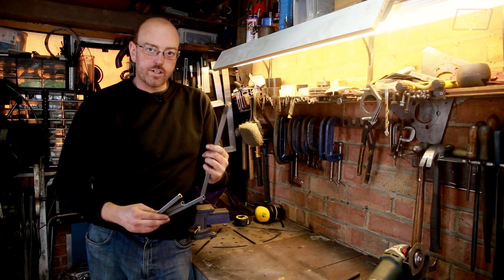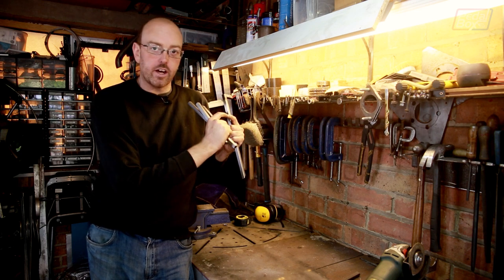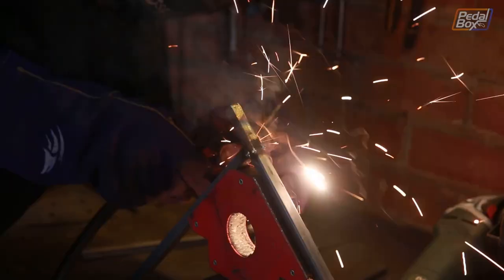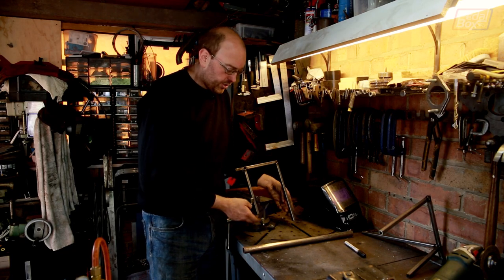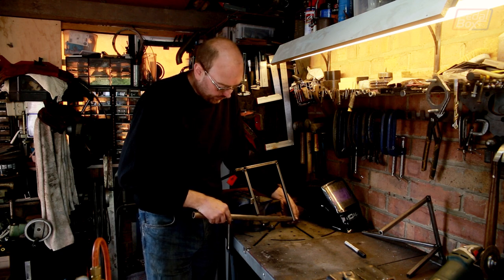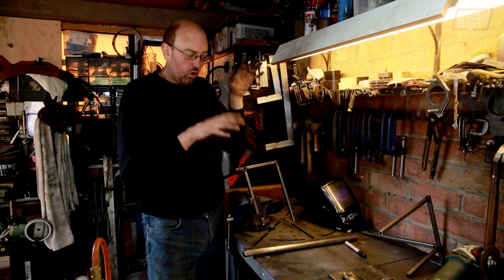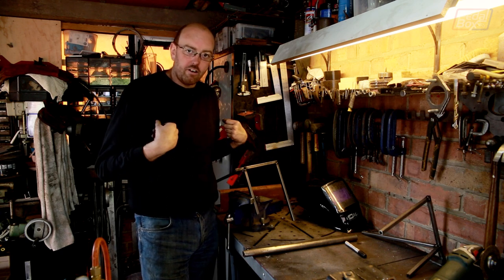Now we've got all the parts cut we can weld them onto our extension and finish building the bodywork support for the back end of the car. There's one more bit we need to add — a piece of inch tube to go at a slight angle down the back of the car in line with the back of the bumper. We'll build this, bolt it back onto the car, and see exactly where we need it between the two points. We can join up these two legs using a piece of inch tubing to match the sides of the car we already have. I'm going to notch out these two sections — we know this is the right length to the bottom of the floor — and this will just be scalloped out to hang off the bottom of the leg. Having this little rake at the back will reduce the overall size of the car so it'll look a little lighter and smaller from the back, and it means we won't rip the back of the car off going up a ramp or driveway.